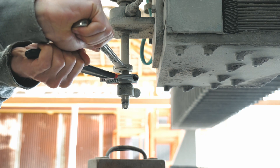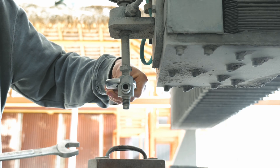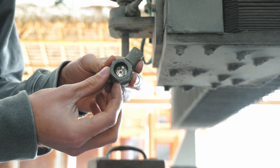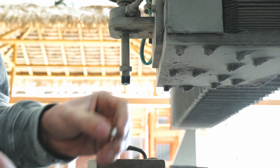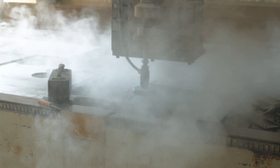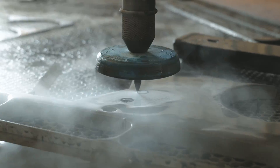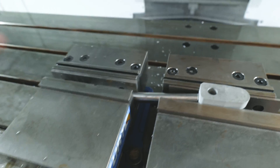For the half inch we're definitely going to have to swap it out. Pull this off — right in there, you can see that little ruby center, that's what gets worn out. Bang it a couple times and it pops right out. Here's what our water-jetted rear axle block looks like, and I've got it set up in the machine already using a rod and another vise as a stop. Next we just have to set up our tools.